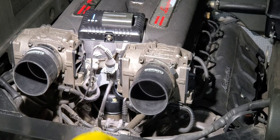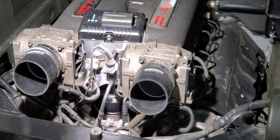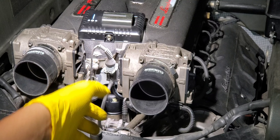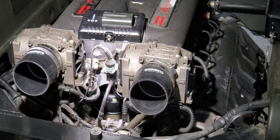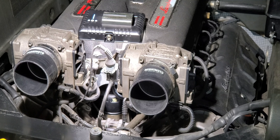At this point I'm going to use my tools to reinstall the vacuum hoses and their clamps. Once those vacuum hoses are on, check everything — make sure that the hardware is properly secured, and when you start the engine make sure you do a leak check. Make sure it's clean around the area so that if there is a leak you can determine if it's new or old residual fluid from the removal process. This section is done. I need intakes on, but I'm going to move on to the oil pot, drain that, and then service the engine.